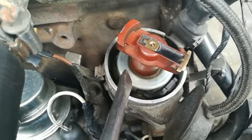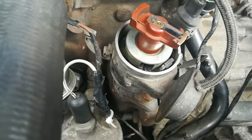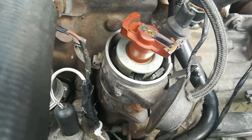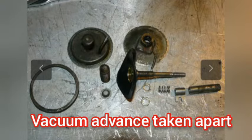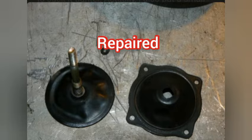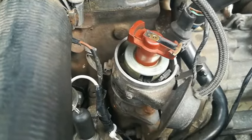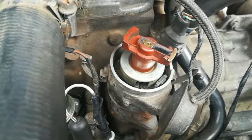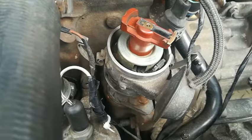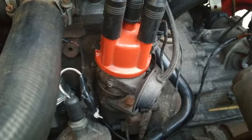I'm going to put up a picture now just to show you what one actually looks like that's been opened up and has been ruptured or perforated — that's on one of the older model cars. Many times we don't tend to look at the vacuum advance unit; we always think it's the carburetor where there's an air leak, but we never look at that. Do yourself a favor — test your vacuum advance unit. Just suck up on it, or if you've got a special apparatus for it, use that. Hope that helps and gives you a better understanding of the vacuum advance unit and its purpose.